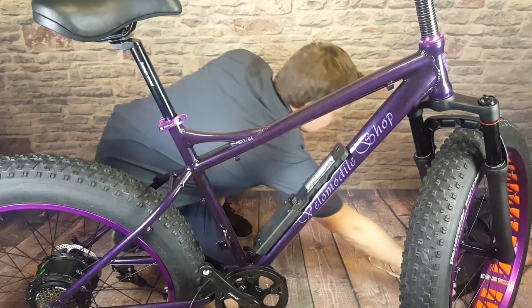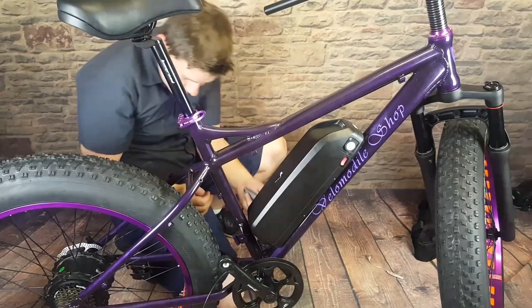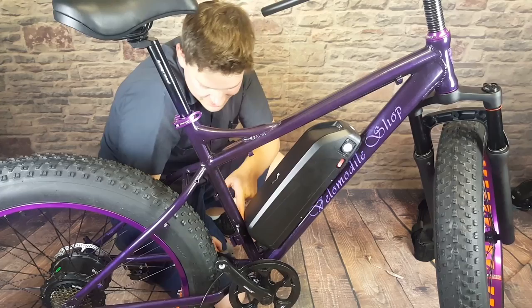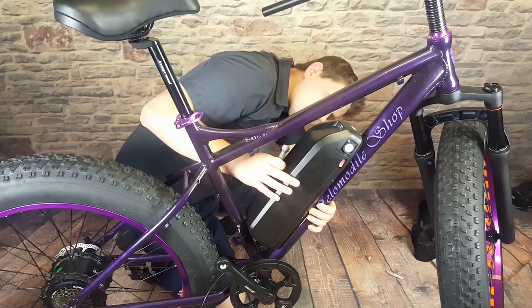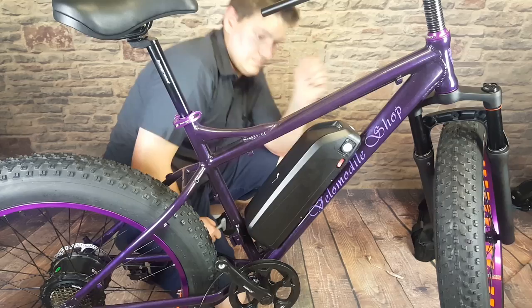With both bolts snug, take the battery and put it on. It looks like we are just right — got lucky and it's in the perfect spot. There's a tiny bit of a gap so it's not going to rub on the frame, and the battery locks on. Always make sure it locks — grab your keys, stick them in there, make sure the battery locks to the cradle, and everything looks good. Thanks for watching. This is one video in a whole series on how to build your own electric bike, so please subscribe and hit the notification bell. Links to the first episode and other videos will be in the description.